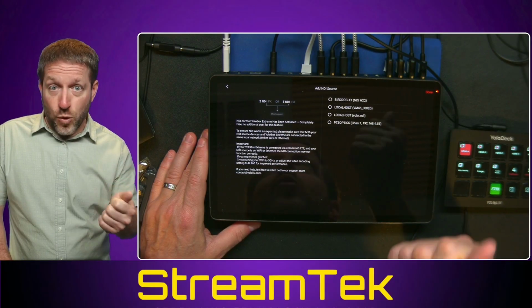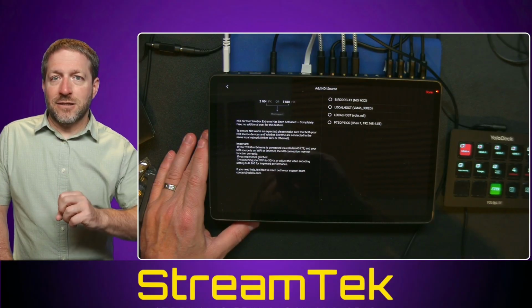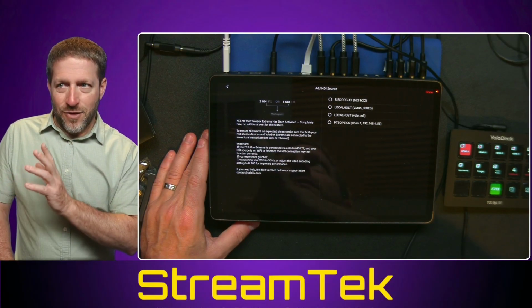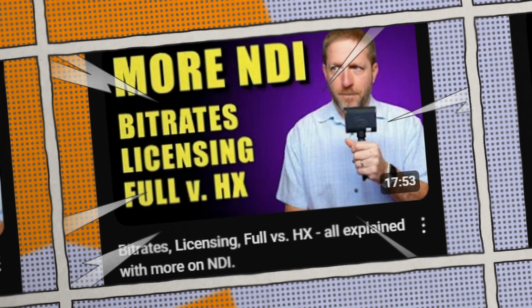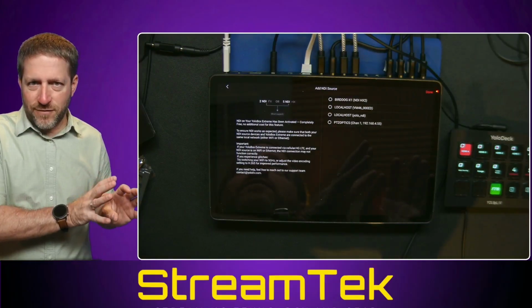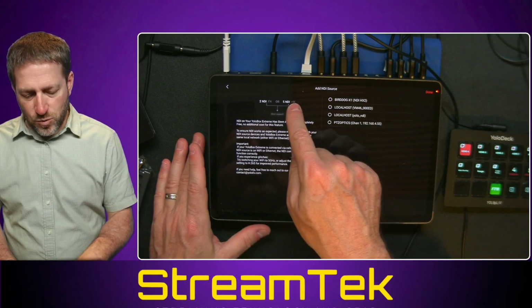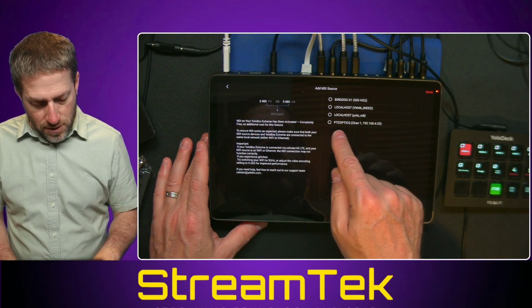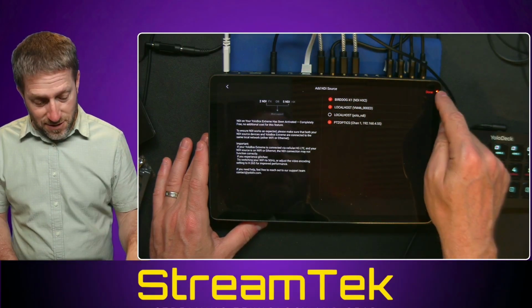It's H.264 or H.265, which is built into here. FX is an older codec that is a lot harder to deal with for these devices. It's not built into today's chips. So it's actually a CPU computational thing as opposed to being handed off to a specific area of the chip designed to handle H.264 or H.265, which is why you can handle those. So there's my YoloBox. I can bring in my own YoloBox, which I'm not going to do because I'm done.